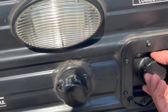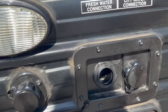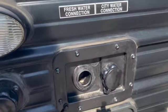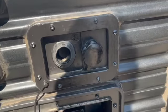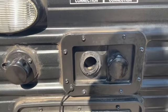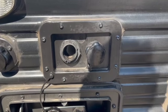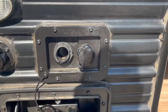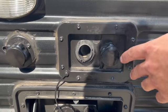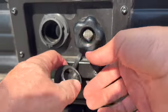The outside shower has hot and cold water. Right here is your fresh water tank — you fill up the tank from this inlet. Right here is your city water hookup for full hookups. When would you use the fresh water connection? When you go dry camping — there are no full hookups, so you use your own tank. The city water connection is for when you have a pressurized water source.